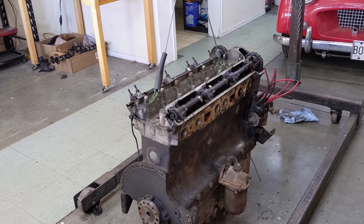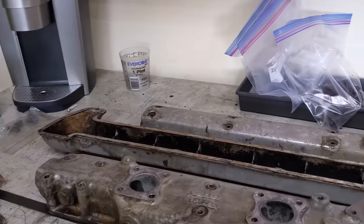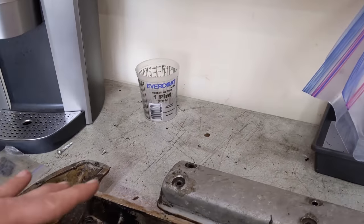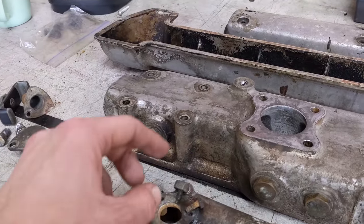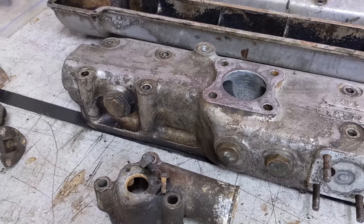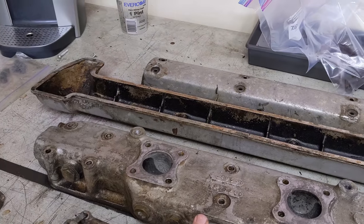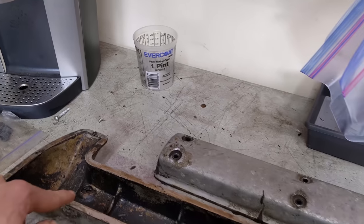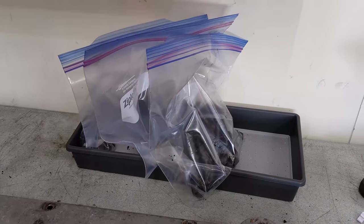We're making progress but we got a long way to go. Before I get ahead of myself, I just want to regroup - figure out what we have, what we're going to do, and what we need to order. I have all these aluminum pieces here on the bench - I'm going to clean them off with a process called walnut blasting. That's a real safe way to get rid of these oil deposits without putting any grit inside the intake manifold. I also need to find the studless gaskets that don't have the holes at the front, to get a proper gasket for this really early engine.